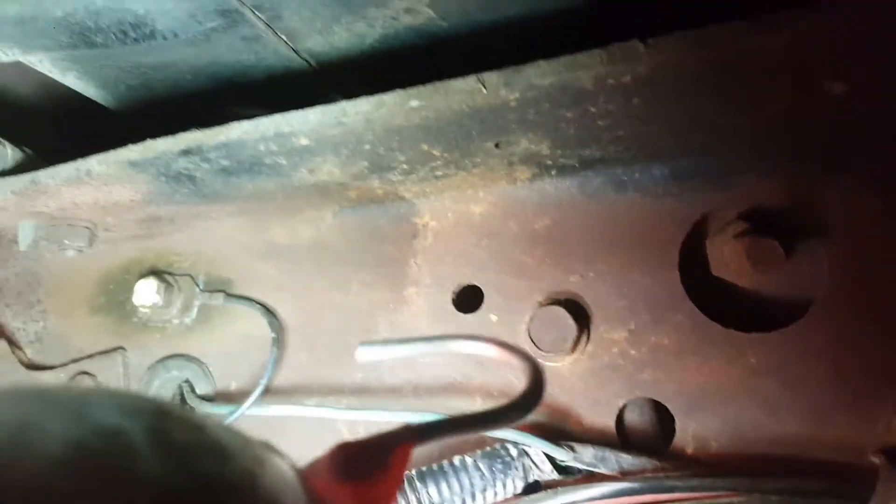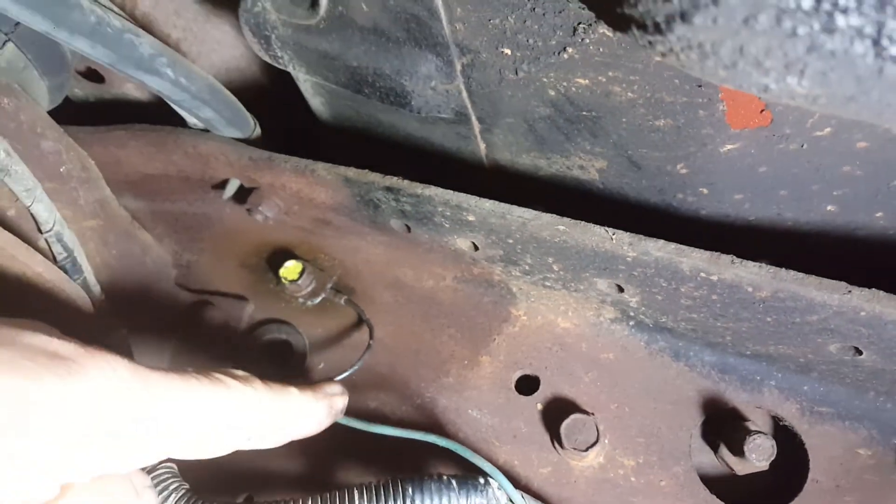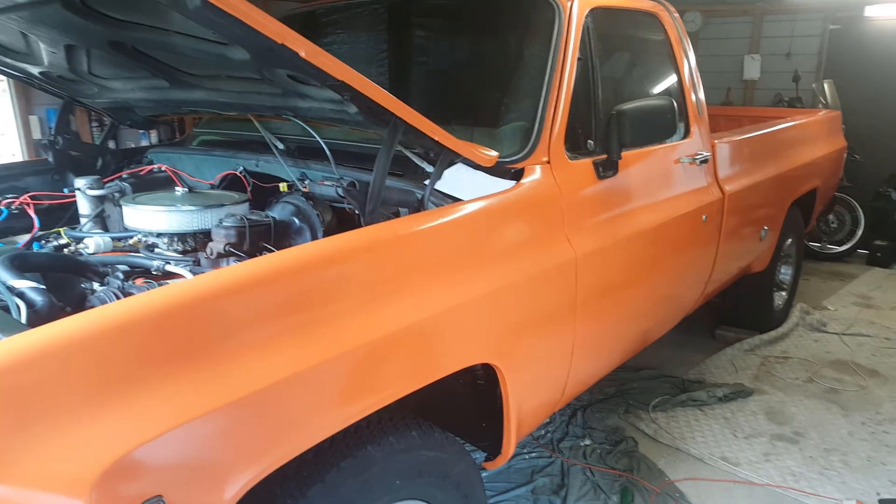That's the driver side wiring — that's the grommet, and that is the green wire, with the ground up top. That's the wire color in the harness that runs up to the front under the hood. The dual tank switch uses that green wire, and it runs down to the tank. There must be a join somewhere in there because that second green wire isn't present. I hope this video helps — please like and subscribe.